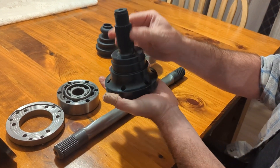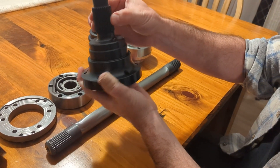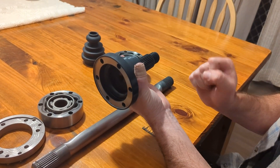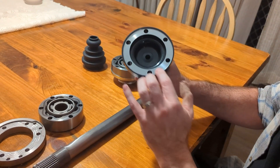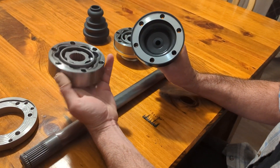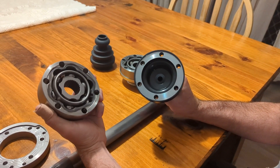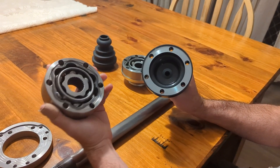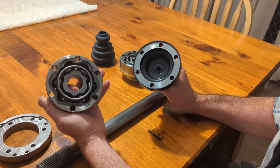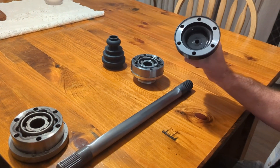This is a single piece of billet alloy that we've heat treated and machined up to replicate the spline of an E46 M3 or 330ci sized hub spline. That then goes straight into the wheel hub as it used to do with the standard cup, except this time we've made it adapt to a 108mm PCD aftermarket CV, which you can find in Porsche 930s, Commodores, and some other cars that use this size universal CV joint. This is a lot stronger than what BMW has in their cup configuration.